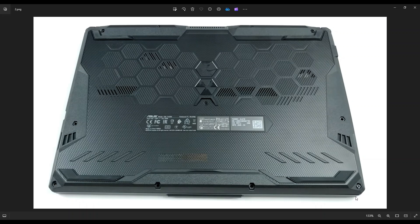You would then use a small flat, preferably plastic pry tool. I say plastic because metal pry tools tend to scratch your case a little bit. Start over here and go around the edge of your bottom case until you can pry the whole bottom case off. Nice and slow but firm, and don't put your pry tool too far in — you could damage some things. Just keep it right on the edge and go nice and slow.